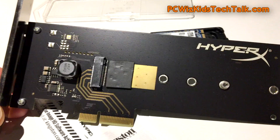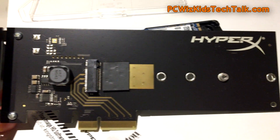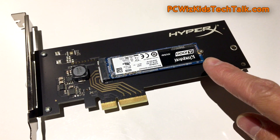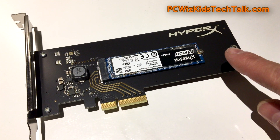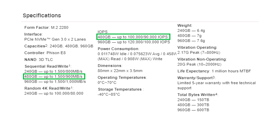There's also a manual. If you have an old motherboard that does not have the M.2 socket form factor, you can use a PCIe card like this — though you have to purchase it separately. You install the SSD like this and slide it into your PCI Express slot. Make sure it's a Gen 3 x2 interface to get the fullest capabilities. If you have a new board, you don't need it at all — just use the M.2 slot and you're good to go.